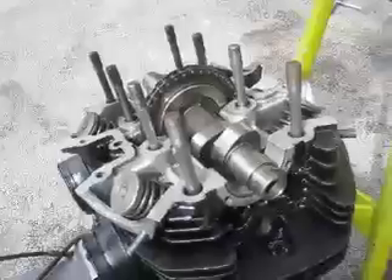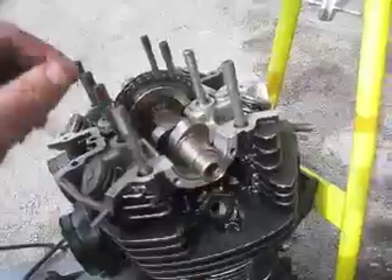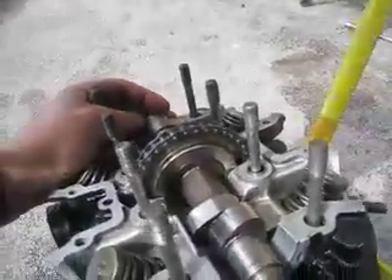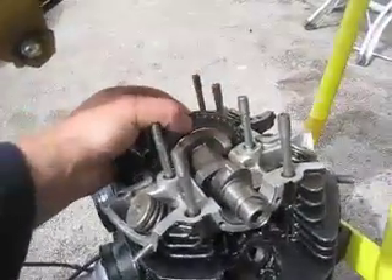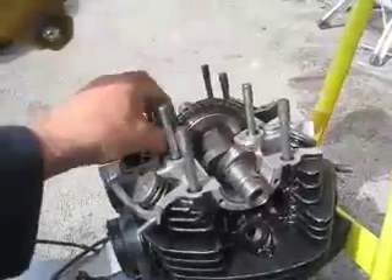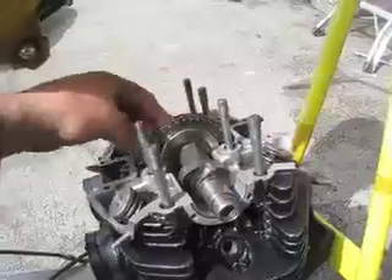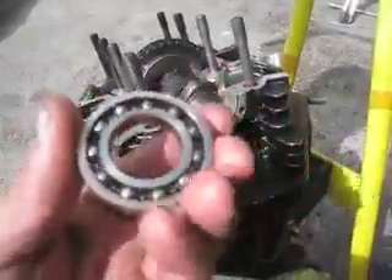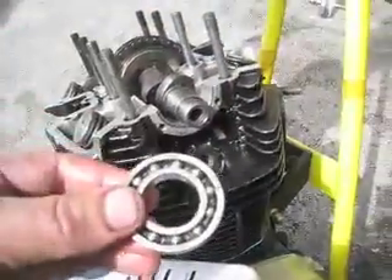I'll press on. The cam is on. You'll see that I took the bearings off and slipped the cam itself under the chain — a bit of a tight fit, a bit of manipulation. There we go, we have some play, enough to put these bearings on. I shall slip those on and position them back soon.